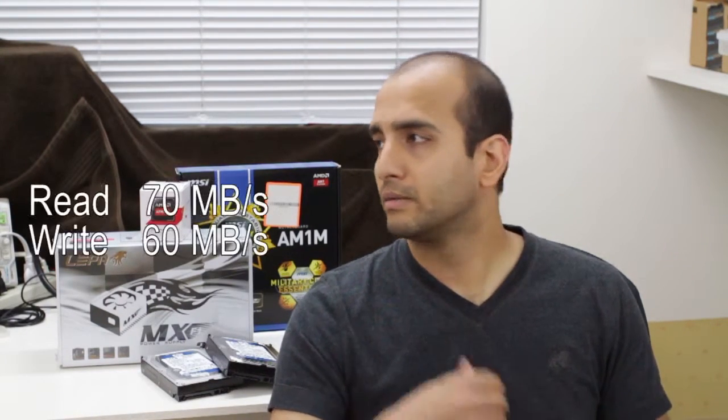Hi folks. In this video I'm going to build a NAS to replace my existing NAS which is about five years old. The primary reason is it's a 2-bay NAS and with two 1.5 terabyte hard drives in RAID 1 I get about 1.2 terabytes of usable space, which by today's standards is not enough and can't be expanded further. The other problem is its throughput is absolutely horrible — you can see these speeds on screen — whereas with decent hardware you can expect much better throughput like what's shown here.